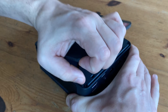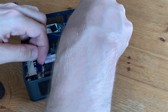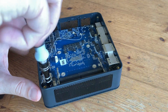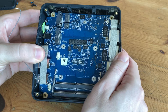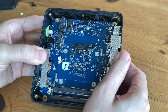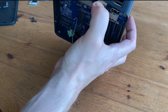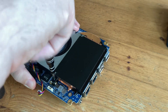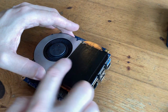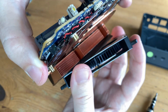So how about we try this one? We've not yet pulled one of these apart to the point we could see the CPU. The last time I asked a representative, he said it was possible but you needed to bend the plastic. I'm going to try pulling out the back ports first, and eventually — oh! From here the process is pretty much identical. The fan is also taped to the heatsink, and by folding over and turning like this, it can be removed with little effort.